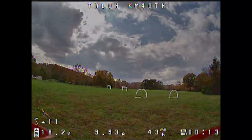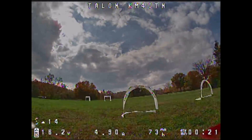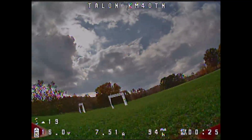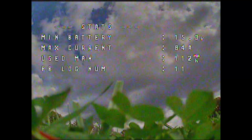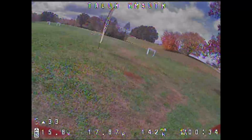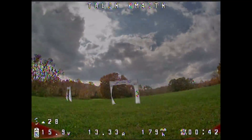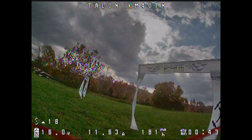Either right now you're blown away by the quality of this image, or you're hating the digital noise. Whichever gut reaction you had when you first saw it should tell you whether this is the right camera for you. The things I like: the dynamic range is amazing — you can see extra detail in the clouds, the sun is not blowing out the sky, you can see the ground and shadow details under the trees. On the other hand, there's that over-sharpening and digital noise, and the Moiré artifacting — look at the top of the air gate where there's a little jaggediness in the line. It's especially visible on fences with horizontal lines or shingle roofs; anything with a repeating horizontal pattern really jumps out.